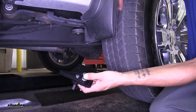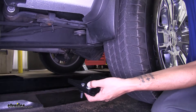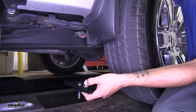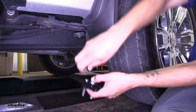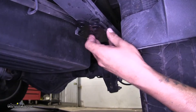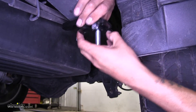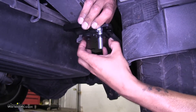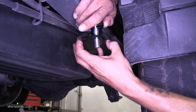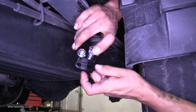Just to give you an idea of how it works — the center hole on the lower bracket is going to mount directly to our overload spring, which should have a pad with a plastic clip going through it so we don't have to do any drilling. Once we have the rest of it in place it would sandwich and use the shims in order to get the right height, and then we could engage our overload spring by turning this using a three-eighths ratchet or extension.